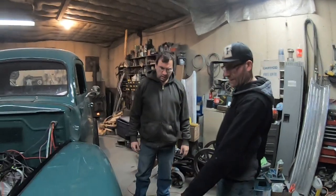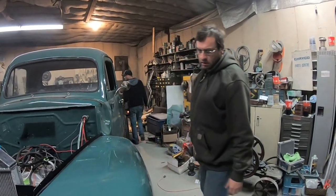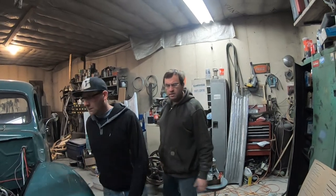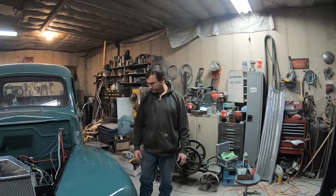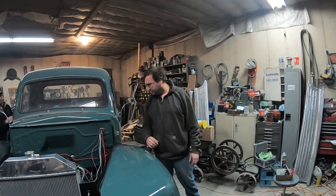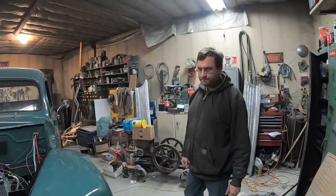We're going to make a gasket for the little fender extension out of the same material and put a couple more bolts in. We're not going to tighten up anything yet until we basically have the whole front end — both front fenders, this piece, and the lower valence on. The holes give you a lot of wiggle room for adjustment purposes.